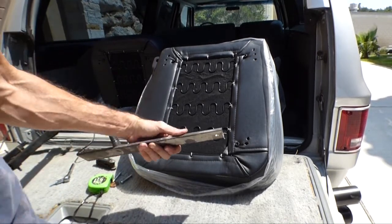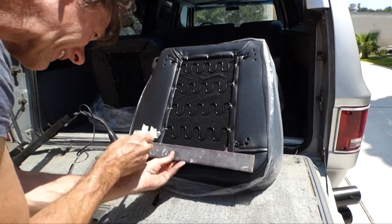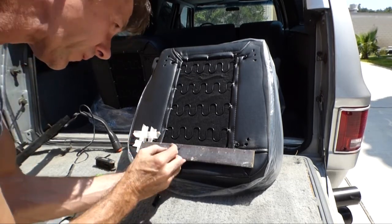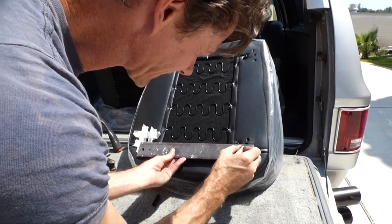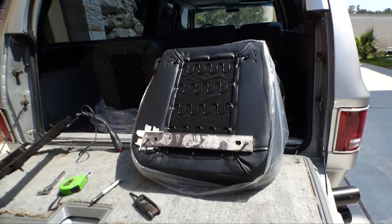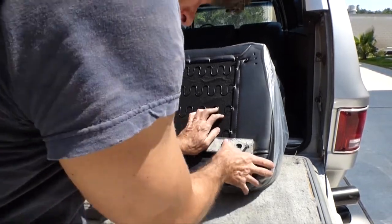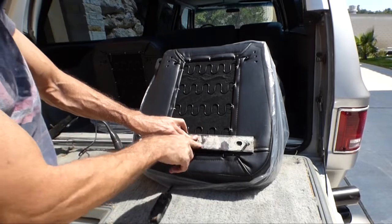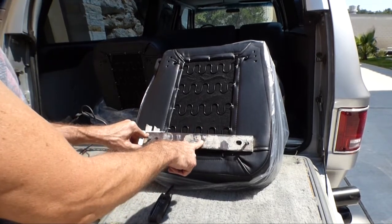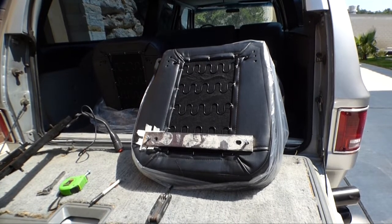Alright, so here's my 1/4 inch steel. I'm gonna have to relieve it for these bolts over here too. So I can drill a little hole there and here. And I think I'm gonna put one right here. Alright, well there's my first bracket, my front bracket, but these bolt holes on top don't match the bottom, so I gotta go a whole new bracket and remeasure everything for the upper or the back. So let's cut another piece of steel. We'll keep going.